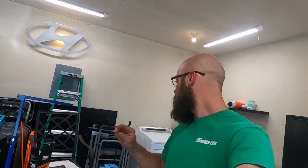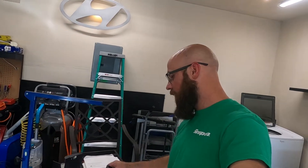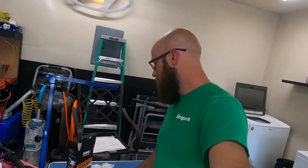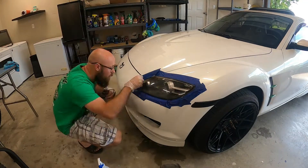I used both sand pads, keeping the headlight wet. Essentially what you're doing is wet sanding any coating or uneven surfaces off the headlight to make sure it's as smooth as possible for the final coating — just a couple of minutes each on each pad. Obviously if you've got heavy oxidization or a thick coating, you're going to want to spend more time on the red pad and then finish it off with the gray. As you can see, that's what it looks like now — still a whole lot better than the other side. Now for the final coat: this ceramic coating — it only comes with two, so one per headlight. I'll make sure the headlight is dry and then apply this coating.